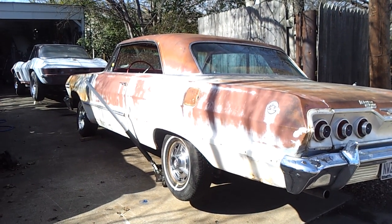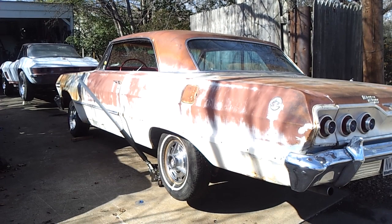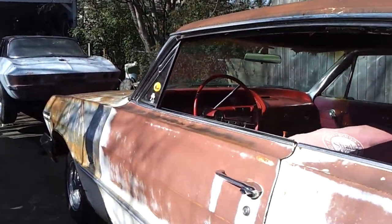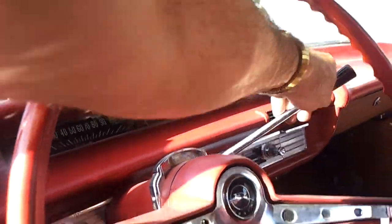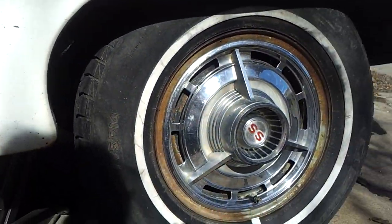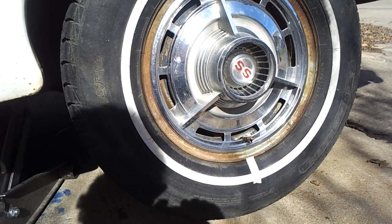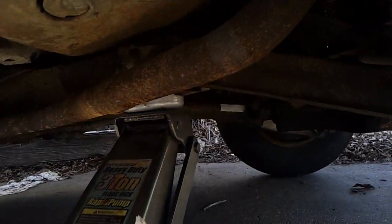On a single-track, you can jack up one rear wheel, leave the other rear wheel on the ground, place the car in neutral, and then spin one wheel. If it's a single-track rear axle, spin one wheel around twice and count the number of revolutions the driveshaft turns. I put a little masking tape mark on this tire about there by the ground.